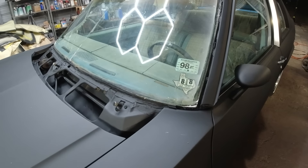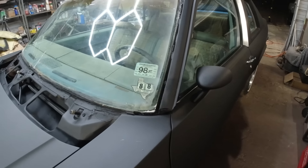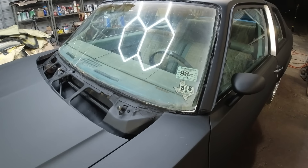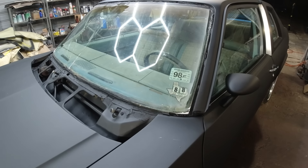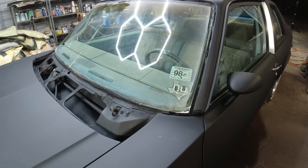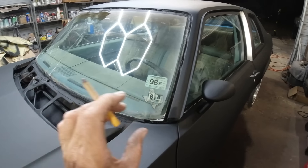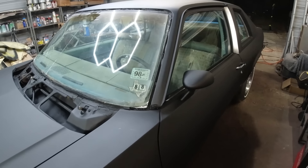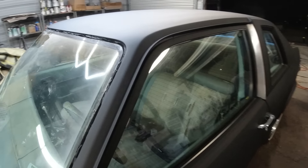So that's why we're leaving all that out until we pull the windshield. It's 125 bucks for the windshield, and about 20 bucks for two tubes of urethane — I'll probably only use one and a half. I like to put it on there pretty thick so there's no leaks — no water leaks, no air leaks, no whistling noises.